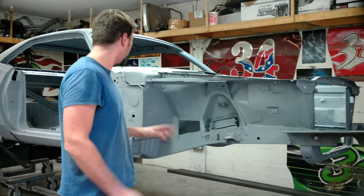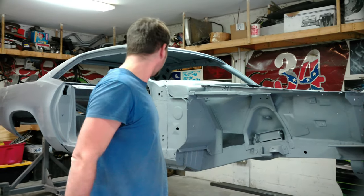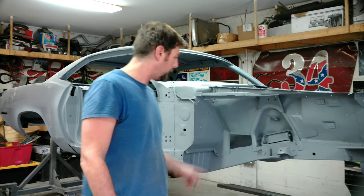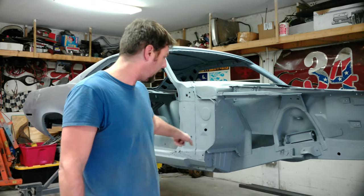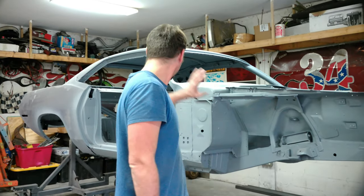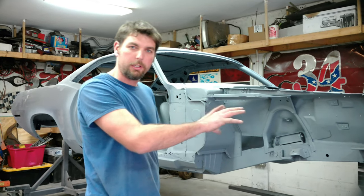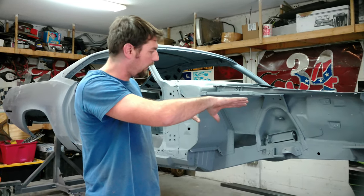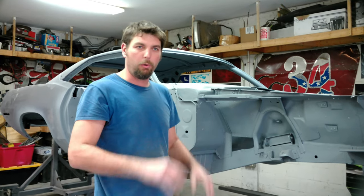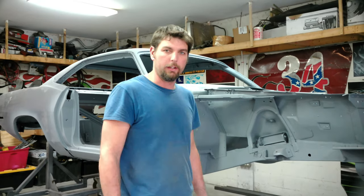We have the car sandblasted and we put it in epoxy. Nothing else has been done to the main car so far. Just going to protect it and we'll start getting panels. I'm going to put it on a frame jig I got for building some race cars, because we're going to cut so much off the back — the car is a little bit rougher than we thought. If we do it on the rotisserie, it's going to fold the car. So we're going to give it a little more support, and I'll see if I can video some of that happening and take you along the process.